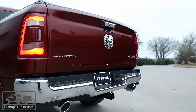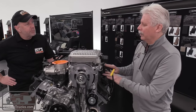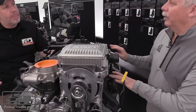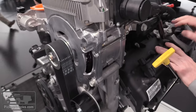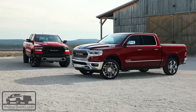What about towing — is there any benefit from this system? In four-cylinder mode the e-Torque helps on some grades, but for towing we rely on the base power of the system. On our upgraded 8-speed transmission we have over 40 shift patterns to select from, and the e-Torque system will automatically choose those. If we're towing, it'll know, and there are also driver modes in the new shift selector you can select.